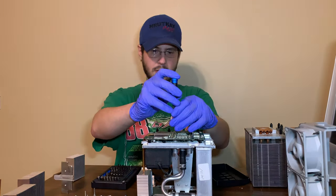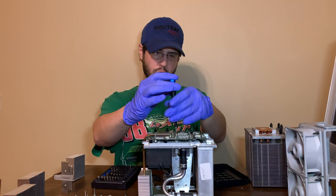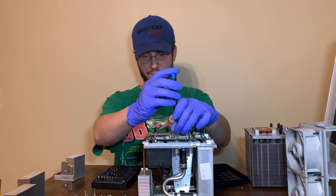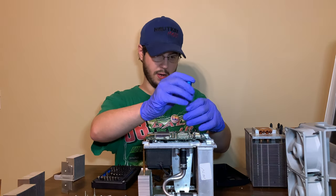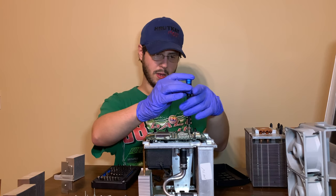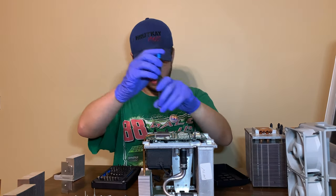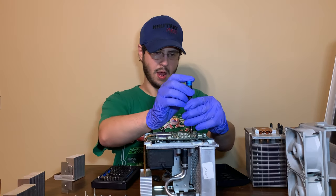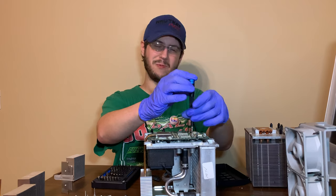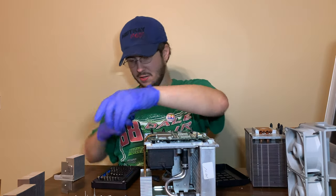So we're going to convert these CPUs to the new heat sinks the second I finish cleaning them. Cleaning them, I'm not going to show on camera, but I'll talk about it briefly. I don't know how you clean Dexcool off. I'm going to use 90% IPA, and I am going to scrub it off with a toothbrush. If that doesn't work, well, might try some vinegar. It does get corrosion off of things. But vinegar also is conductive, if I remember correctly, so I'd still have to clean it off again with IPA. Decisions, decisions. If I'm lucky, I don't have to clean this card.